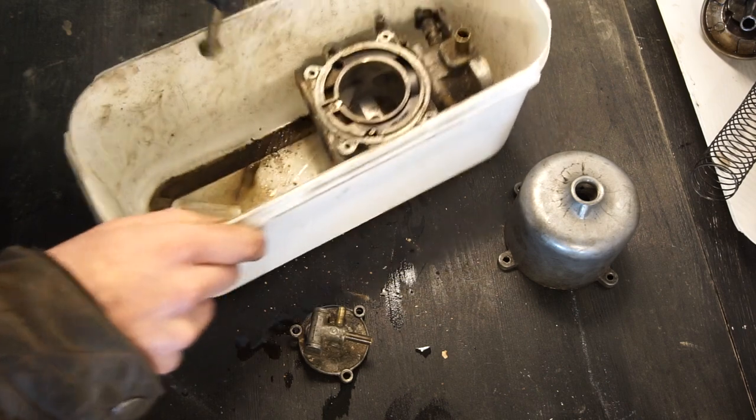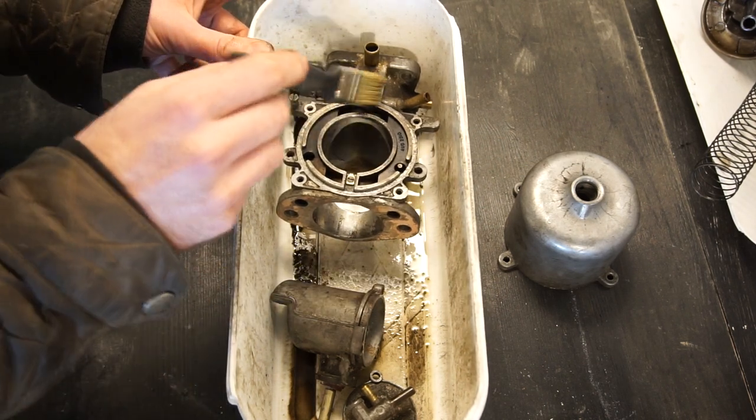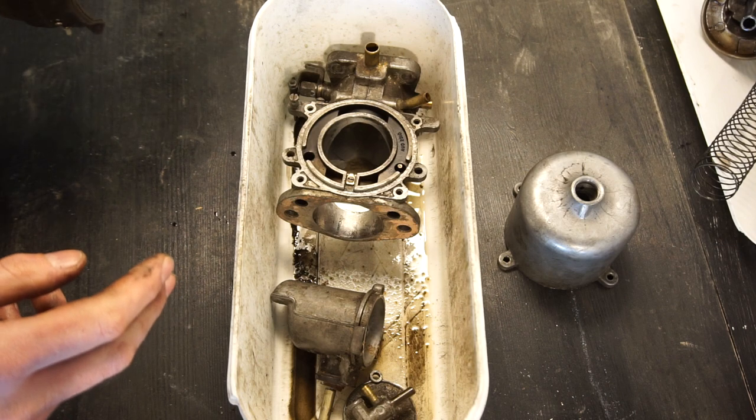The next step is to take all the parts and put them in a container — I like to use big plastic containers from old ice cream tubs — soak them in various types of degreaser, use small brushes to get into all the crevices, and basically get them really nice and clean. When that's done I can assess all the parts even more, make sure there are no cracks, and start polishing. But that will be in the next episode. That's it for part one — part two will be up in just a few days. If you're not subscribed to the channel I highly recommend you do so. Hit the subscribe button and bell notification so you won't miss any future updates. I've already made a video explaining how SU carbs work inside — I'll put a link up above and below. If you like this video please hit the like button, share it with your friends, and let me know in the comments what's the favorite car you've had that had SU carbs. Until next time, I'm Adam and this was Living with a Classic — I'll see you soon.